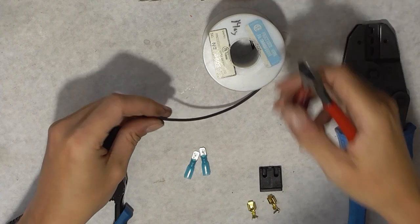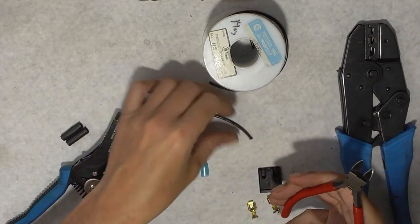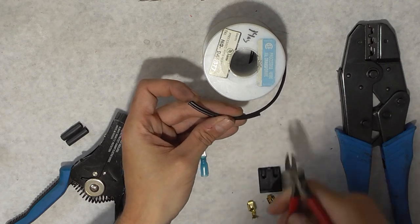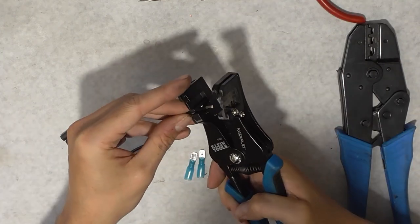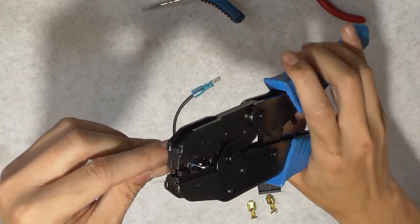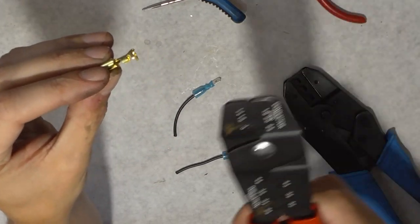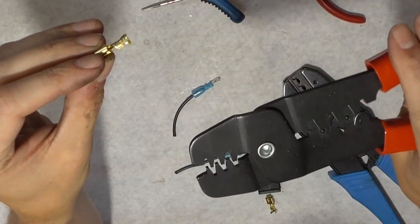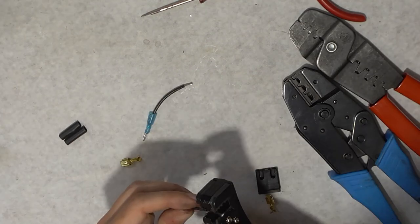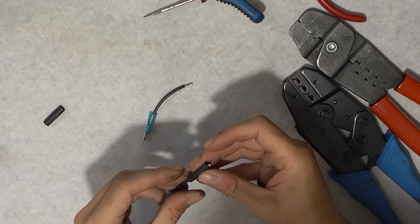The gauge needs to be the same or larger than the original stuff that's there — something about two to three inches. I'm using 14 gauge because it's a little bit easier to work with than 16, although 16 would be fine. Probably 18 would be fine, but whatever. Splice city splice. These terminals are a bit goofier. I have another crimping tool that's not quite designed for this, but it looks about the same, so I'm going to give it a whirl. Sliced and diced. Don't forget the shrink wrap — a little bit of that action.